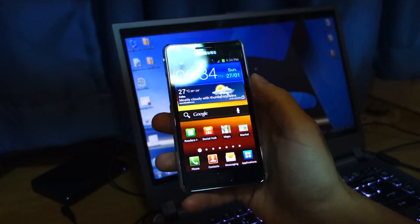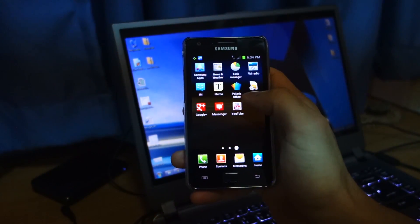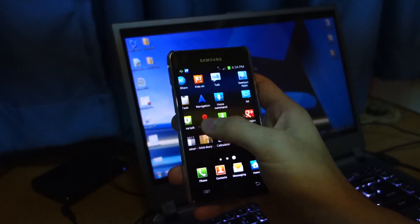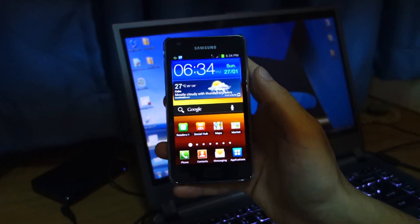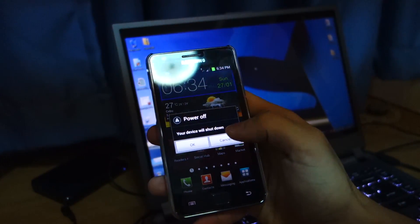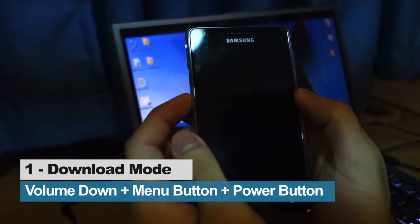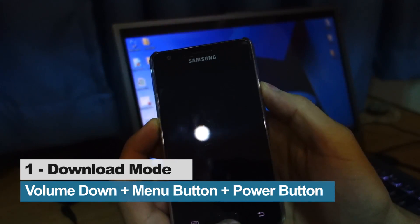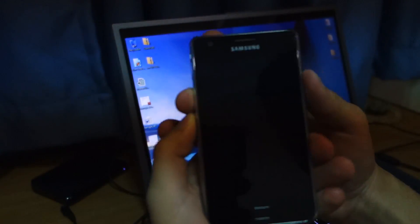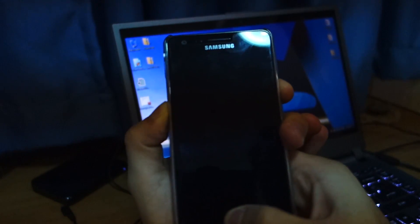So it's pretty easy. What you first have to do — as you can see, this is a fresh copy, just installed, of the Samsung Galaxy S2. Just a complete fresh copy, like when you do a format on your computer. The first thing you have to do is put it into download mode. Switch off the phone, then press the volume down, menu button, and power button at the same time once the phone is fully off. Press those for about 10 to 20 seconds.